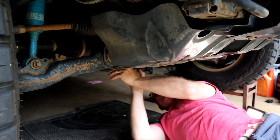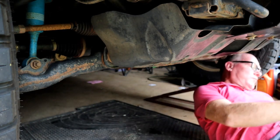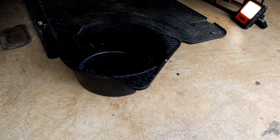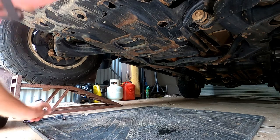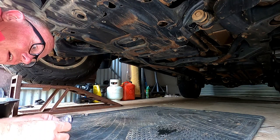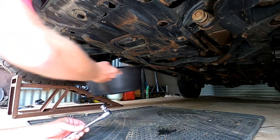Usually there's a whole lot of dirt and sand that comes out, but not too bad today. So that plate just comes out just like so, and the sump plug is just sitting in here. The sump plug's just up here — I've got a socket size which you'll need, which is number 14. Just leave all your sockets out nice and neat so when you need them again to put it all back together. So as I said, this is a 14, so we're going to undo that.